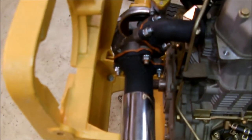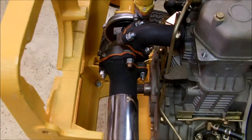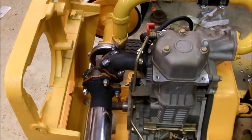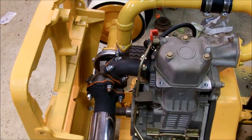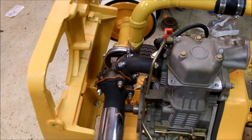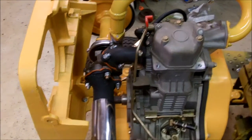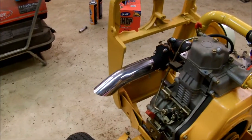While I was leaving that to dry, I made the actual exhaust here. So there's the flange where it goes onto the turbo. I found the gaskets — I mentioned in another video that they didn't include the gaskets, but I found them in the bottom of the box in the packing. For some reason they weren't with the rest of the gaskets. I put orange RTV on them too, just to be extra sure, because they're actually just aluminum gaskets — solid metal. And I put this little chrome pipe on here as my final exhaust. That's where everything's going to come out.